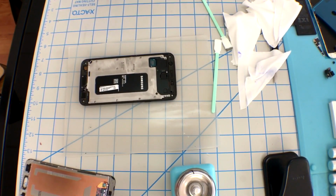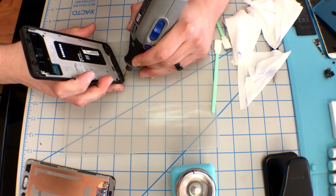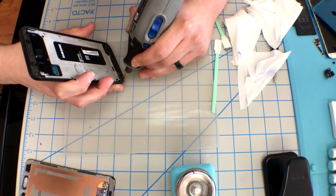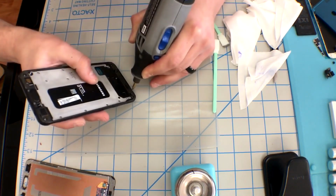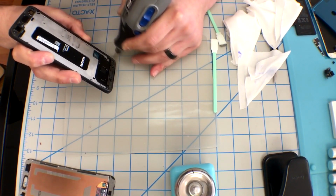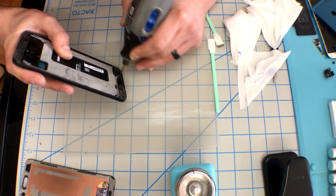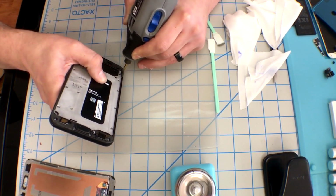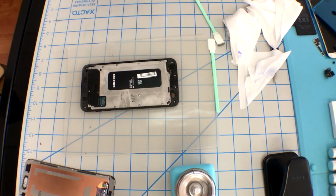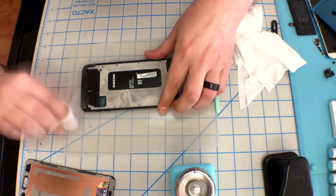Now, like every screen that you have to glue in, cleanliness and frame structure is very important. The corner on this particular one was damaged enough to where the new screen would not sit flush. I use a Dremel tool to smooth it out. At certain speeds, it starts to melt it. Gotta be careful. I've been doing this for a long time, so my free hand is actually pretty good at this. I get it to where it works perfectly, to where I can put my new screen in after cleaning.